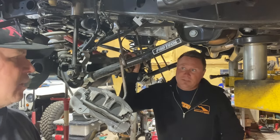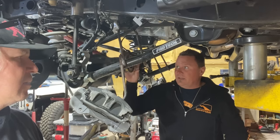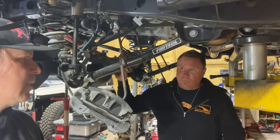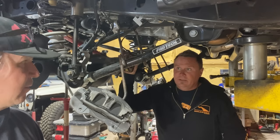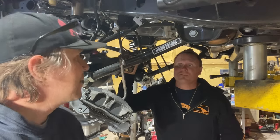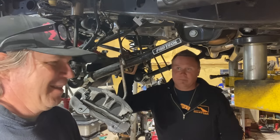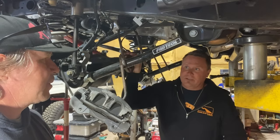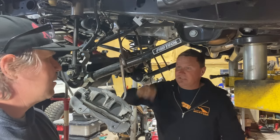And if it's under tightened, then it's moving, your pinion pattern, or your ring gear pattern, is gonna walk every time you put it under power. And also kablamo. So no kablamo is the way to go. Yeah, we're shooting for zero kablamo, which in most cases is about 24 inch pounds on a regular new bearing, which is exactly what this is right now.